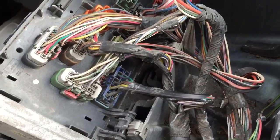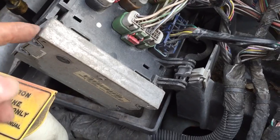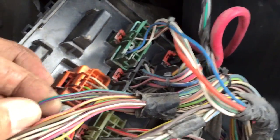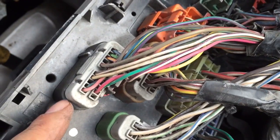So the project today is the horn won't blow. This module on the front here runs about $300 to $400, maybe used a little cheaper. The other fix would be to find this wire — that color — going into this module here.